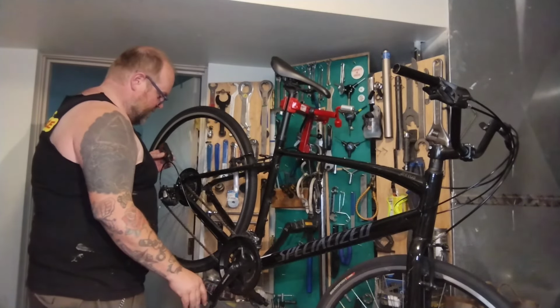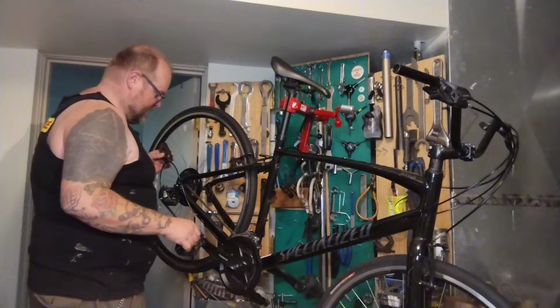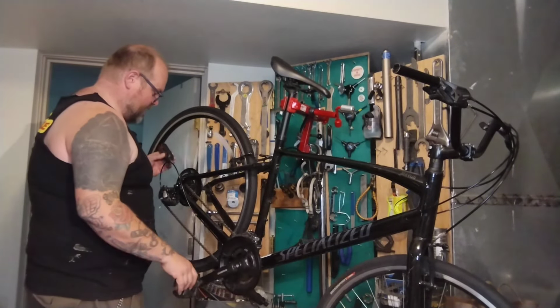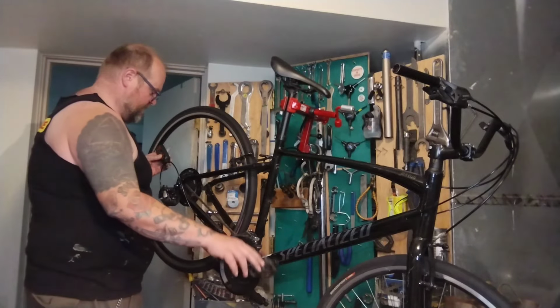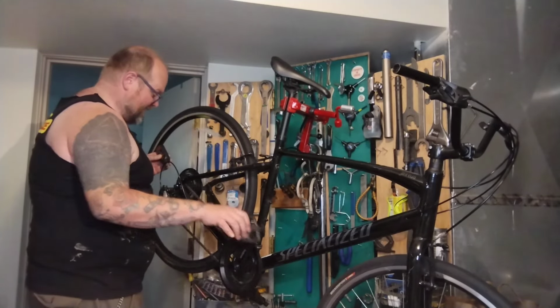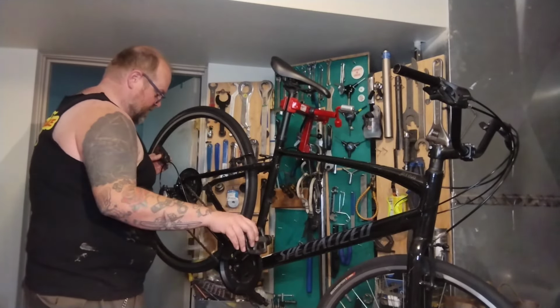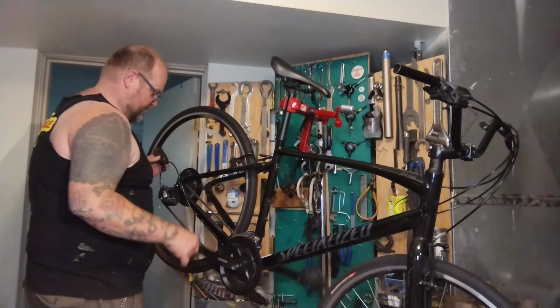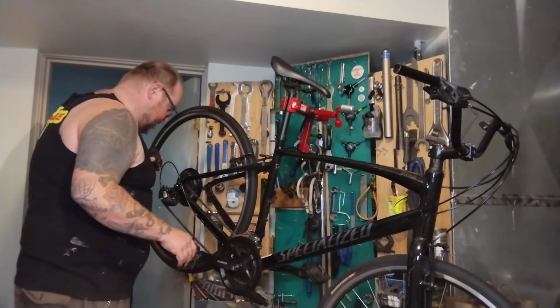With that lube, just to make that rust disappear and get inside those pins. Make everything quiet, no squeaks. We're gonna adjust these brakes. We're basically doing an entire tune-up for free to make this bike nice. It is what it is.